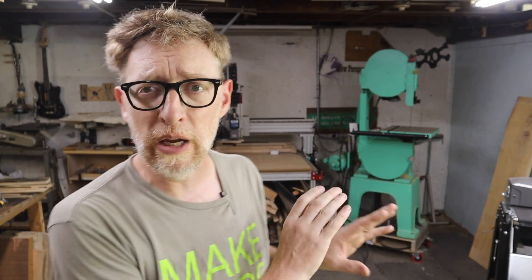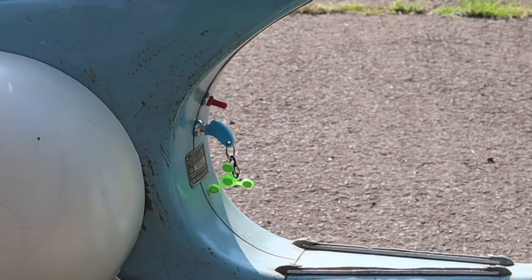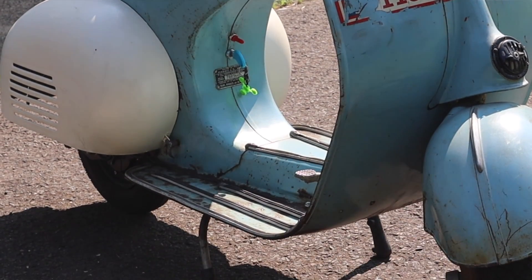When Matt from Spark Cycleworks and I originally built the bike, he was — and is still — thinking about making some type of DIY kit available to customers. One thought he had was making a project box to hold all the switches. In the first version, we had a project box just magneted to the side of the bike with the on/off switch for the headlights. But I didn't like it because I kept kicking it. So I drilled some holes and mounted my key and my light switch into the body of the vehicle. Basically the key turns the 72-volt stuff on and the switch turns the 12-volt stuff on — that's really all there is to it for controls.